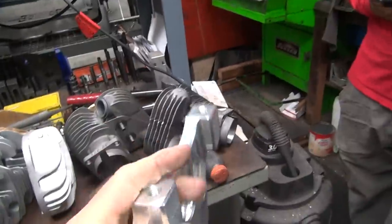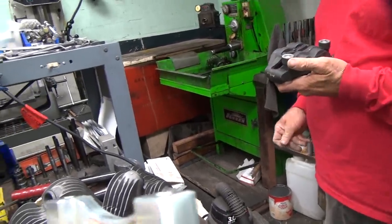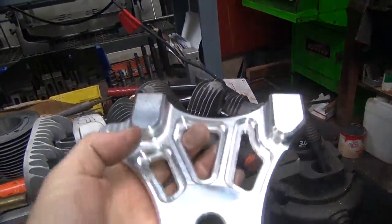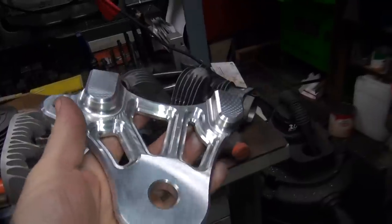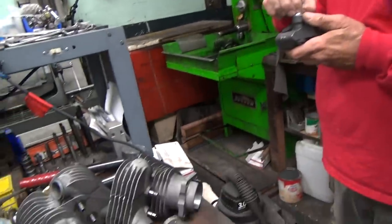I would say that these aren't going to work because there's no dowel pins in these. So you can't go without it, can you? Well, I could do all kinds of stuff if I wanted to, but this is your bike, not mine. Why don't you get a caliper that's made to go in your bracket, or a bracket made for a caliper? Well, that's what the guys recommended — to buy this brand of caliper to fit that bracket. Going by the quality of what I saw already, that makes perfect sense.